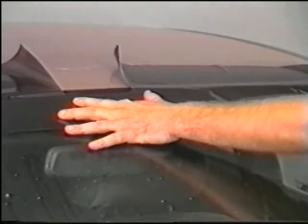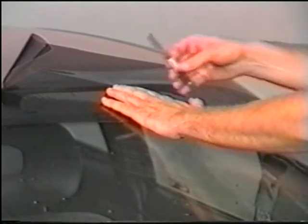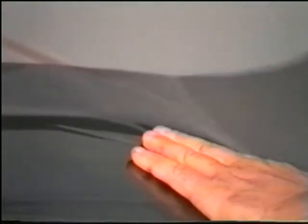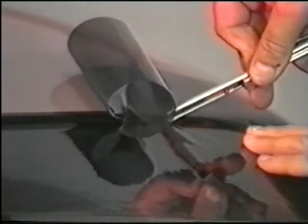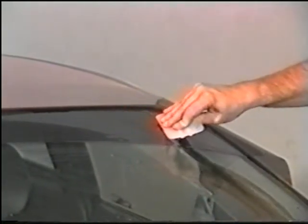Tear away the film. Smooth out to one side and cut a little more. Again, remove the scrap. Notice that the film begins to stress around the corner. This is where you need to stop cutting. Continue until the pattern becomes smooth enough to use your hard card to completely tack it down.